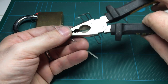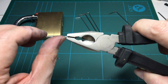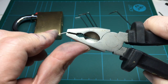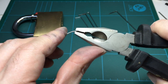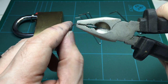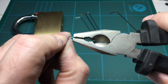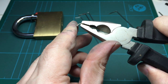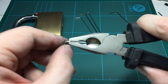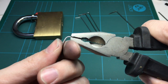So when you are putting bends into this cold, I would suggest just a little tip. Bend a little bit at a time, use your fingers, and put a little bit more of a curve in than you might expect. Now, it does depend entirely on the metal they use for the wiper blade insert. It really, really does. So there is no kind of magic rule, I'm afraid. You'll just have to give it a go. Plus side, wiper blade inserts are free or very, very cheap, so if you make a few mistakes, don't worry about it.